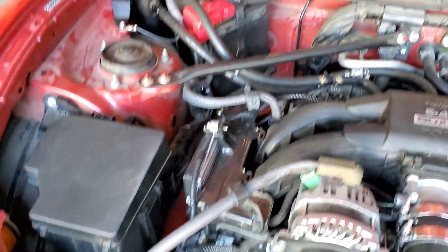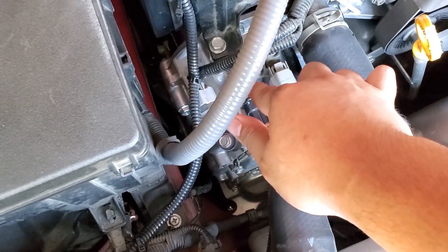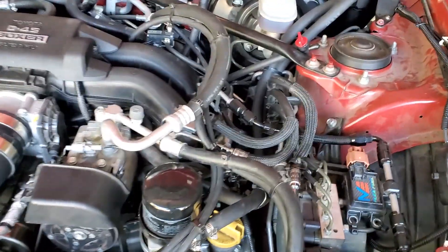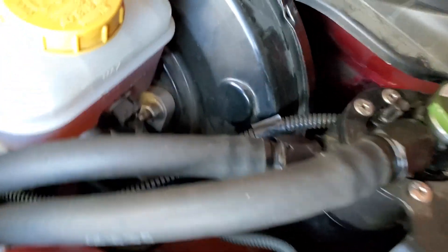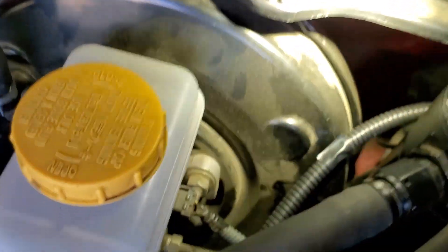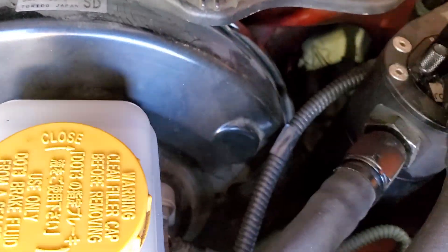The O2 sensor here will come off and you can set it wherever — I hid mine to keep things a little cleaner. You can wire this as clean or as creatively as you want. As for the gauge, it's wired all the way through here into the firewall. Let me grab my flashlight — the firewall is right over there, so you squeeze the wire in that way.